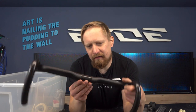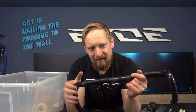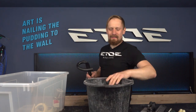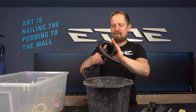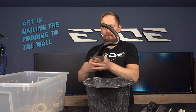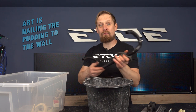Before we can start dipping we have to prepare the surface. If you have color on these parts you have to remove it. You have to sand these parts and primer them. Dipping is cool but preparation is cooler — that's what makes it high quality and durable. Use a bucket of warm water, some wet sanding paper or a scuff pad, and scuff all parts for a flat surface and good adhesion for the primer. When I'm ready I'll come back and show you how to apply primer and what primer to use.